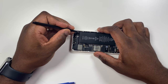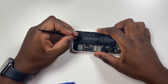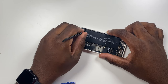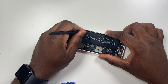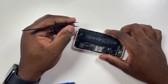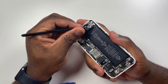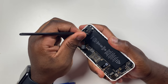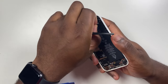Next it's time to remove the battery. The battery is held in place via adhesive strips that run down the entire length of the battery, and these strips can be very awkward to remove. Use a tweezer below the bottom of the battery to unfold the battery adhesive tab — this will allow you to reveal the head of the adhesive strip and help remove the battery. Pry the adhesive tab away from the phone before it breaks, but pull too hard and this will happen.